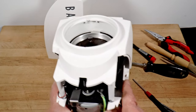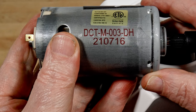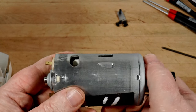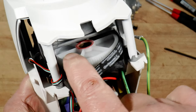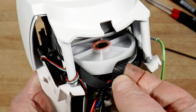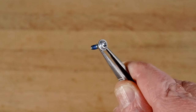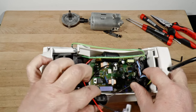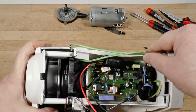The motors are the same as the Forte but the gear ratios aren't, so the Forte is faster; it's also quieter because it has a metal shroud. The motor shaft gear is gray plastic as it should be — not metal, which would be a bad choice with this belt drive. The other gear, which drives the lower burr carrier, is also plastic with a brass insert for the drive mechanism — it's a good design; plastic is tough but it won't tolerate friction against metal. I found nyloc blue patch on all fasteners subject to vibration — a nice touch. Everything is nicely laid out with economical use of space, and there's very little ground coffee outside the grind chamber. The main PCB is also well made with quality components; the wiring is simple, sensible, and reasonably neat.